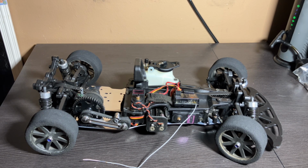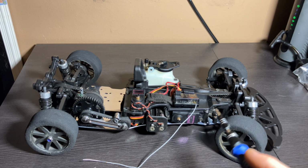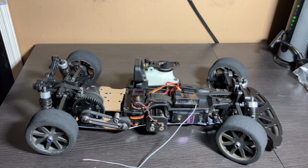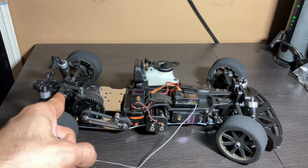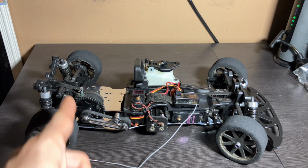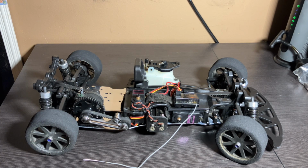So a quick overview of what not to do is not to over tighten your lug nuts, and replace them if need be. Tensioners, don't over tighten them, center and front. And I'm gonna say also the wheel inside, because remember, there is a tensioner inside of this diff. So remember not to over tighten that one as well. And if you went over your vehicle from front to back, you shouldn't have any issues with tension binding or any dragging your vehicle at all.